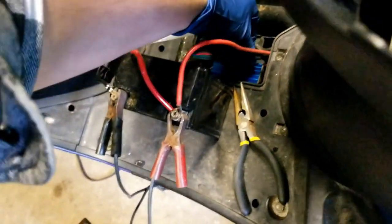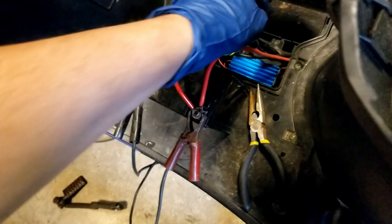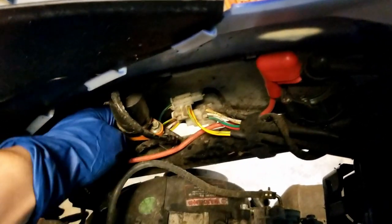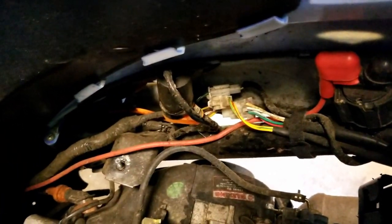I don't know exactly what this one does, I'm gonna have to get the light in there. I'm gonna figure out what this wire does — I'm pretty sure this one's directly to the starter solenoid. The starter solenoid also isn't clicking at all, which makes me believe it might be dead. I also want to check the switch where this wire goes into the loom; it might not be connected or something stupid. I'm gonna dick around before I turn this back on and we'll see what happens.